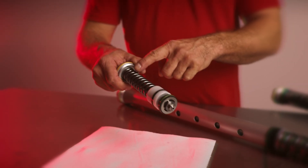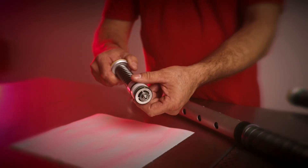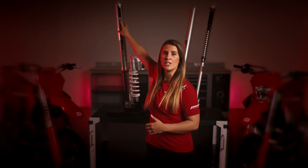Additionally, the damping cartridge of the closed cartridge fork appears different, and the upper part of the cartridge in a closed system contains another spring. But here's the most critical difference: in a closed cartridge system there's a separation piston that isolates the oil in the inner tube from the rest of the cartridge. With this setup, the oil in the inner tube of the cartridge is pressurized and separated. This means that no matter how high you jump or how rough the terrain is, this closed system prevents the formation of vapor or tiny air bubbles in the oil because the oil is not getting shaken and mixed as much. This phenomenon — the formation of little air bubbles known as cavitation — is virtually non-existent in a closed cartridge system.